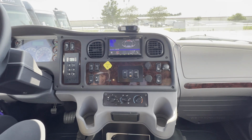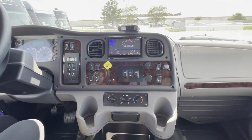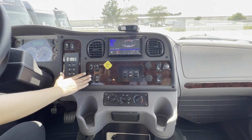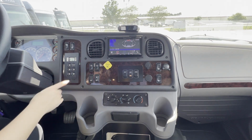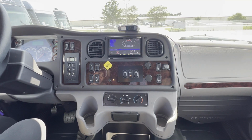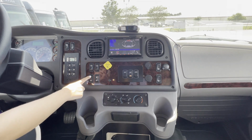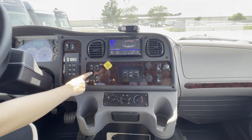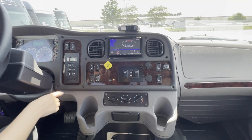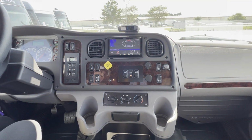If we're going somewhere really steep, going downhill through mountains, Colorado, into, what is that, Jackson Hole, stuff like that, this is where you want to flip on that engine brake, and it'll be pretty loud, and you'll hear it shifting down as you're going down that mountain. And then take this off whenever you are back onto flat ground. And then be sure to look for any signs that say, hey, don't use your engine brake in these areas. Make sure it's in the off position.